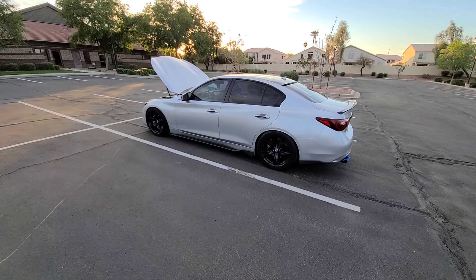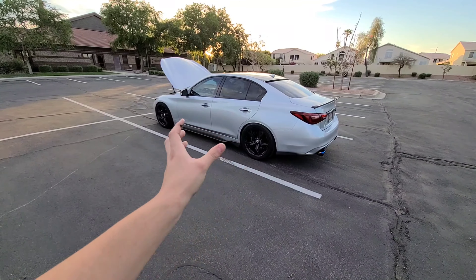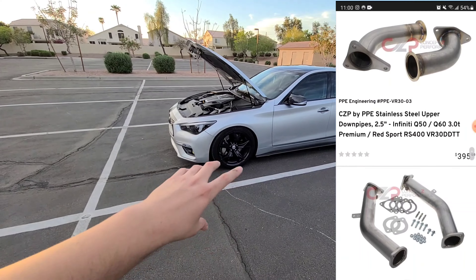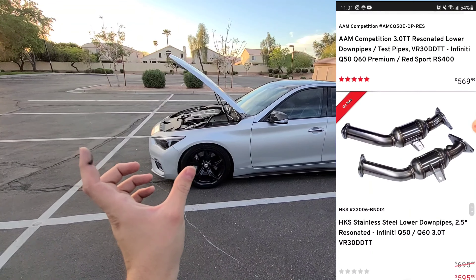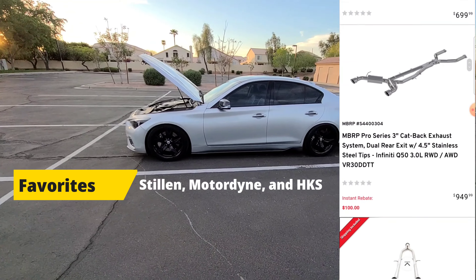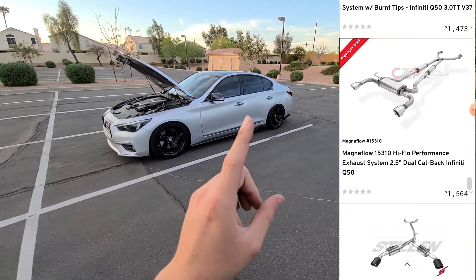The exhaust sounds pretty good. It does have a little rasp when straight-piped, but with one resonator it sounds a bit better. On this turbo platform the rasp appears around 3k RPM and then fades at higher RPM — different from the VHR platform where rasp is constant. Exhaust brands include AMS, Megan (one of the most popular and affordable at around $100), and others. My favorite catbacks are the HKS and MotorDyne — they're pricier but the best sounding. Arc and Fast Intentions are also available.